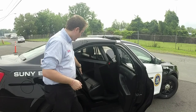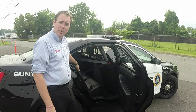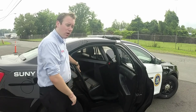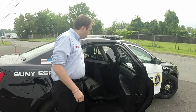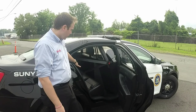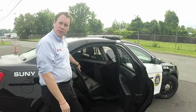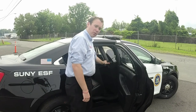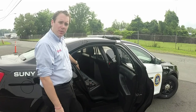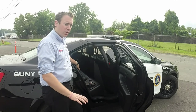The seat is a TPO seat — same material as the door guards — and it goes right over the existing back seats. There's no need to remove the bottom or top seat once everything's installed. The seat belts no longer come from the outboard or inboard side of the occupant, which makes it much, much safer as the officer goes to insert somebody into the vehicle. He's no longer reaching across somebody in the back — all he has to do is come to the stowed location and buckle the person in. The person is safely secured, and the dangers the officer faced when having to reach across to fumble for seat belts are eliminated.